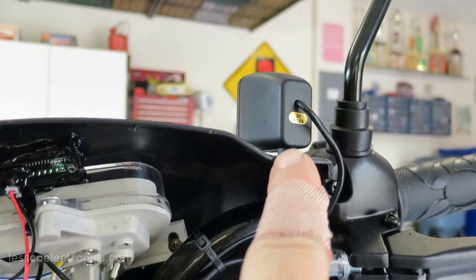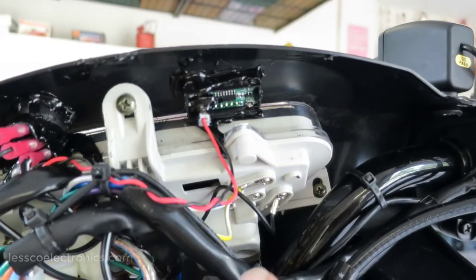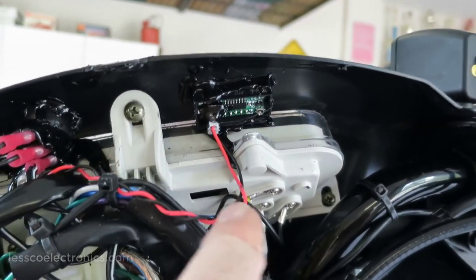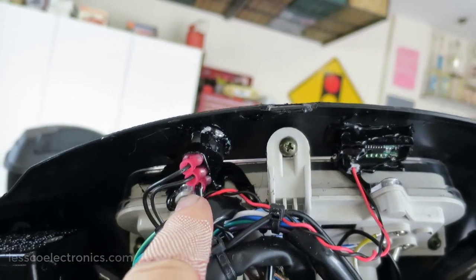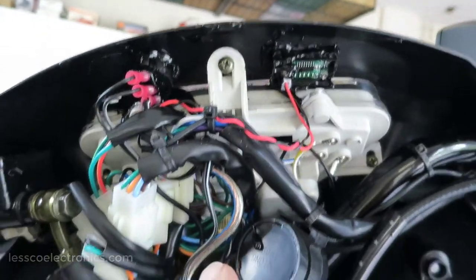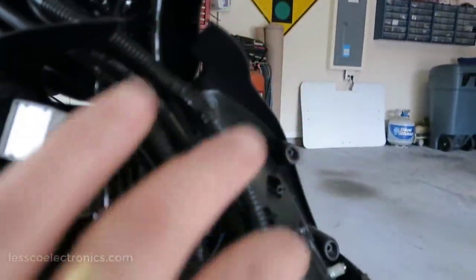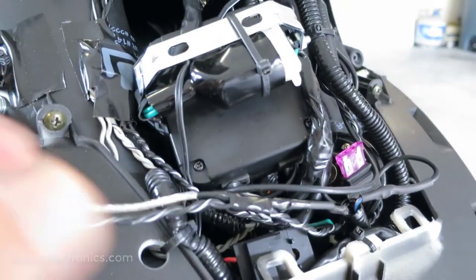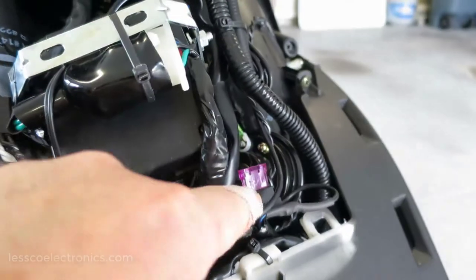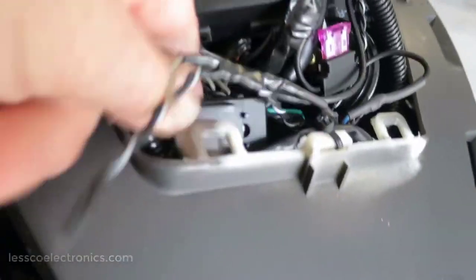So here's a quick shot of the underside before I seal this thing up. There's my volume auxiliary input controller routed down here through this harness. This here is my voltmeter ran down to an accessory, and this one here is my illuminated switch for an accessory, which all runs down right through this harness right here, and it drops down to the amp. This here is going to be for the light switch, going to be installed later on. Independently fused here. There's another fuse holder right in there.